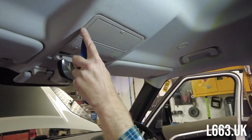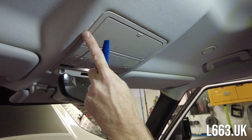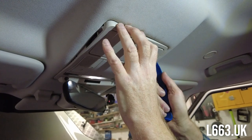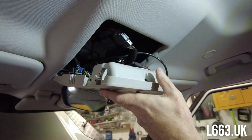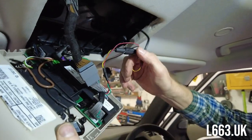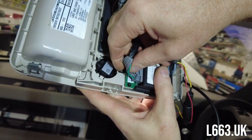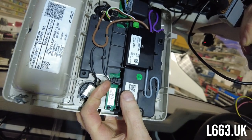To get this out, you've got to sort of put this in. Now, if this is the centre line here, you want to go just forward towards the front windscreen of the centre line. Stick this in here and that will release the clips. Do the same on my side. Now in here, yours will not be as complicated as mine because we've got a couple of these old wiring looms in. To remove this connector, you've got to press down on this middle bit here - there's a middle bit in the middle of the connector and that will release it.